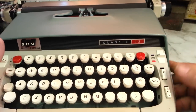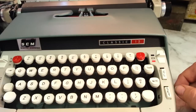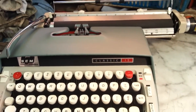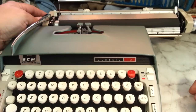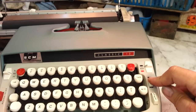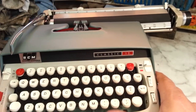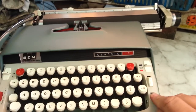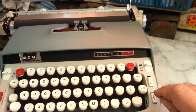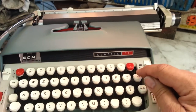This side has the tab set and clear. Tab is right here - on some Smith Coronas the tabs are up top, but on this particular model they put them over here on the side. They all work the same way. There are stops along the way - one, two, three, four. You can clear these by holding Clear and pushing the carriage back, and now it shoots all the way over. To set a new column, hit Set. Another stop right here - Set. Maybe another one here - Set. Now it stops at those spots: one, two, three when you hit Tab.